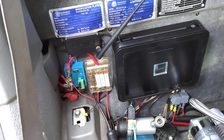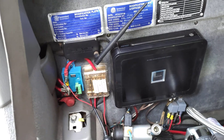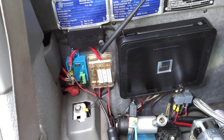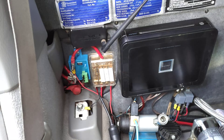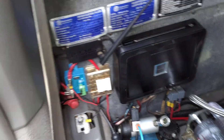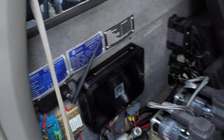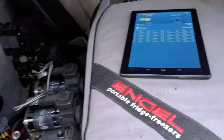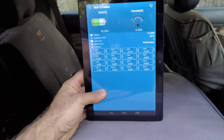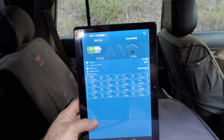It's a $65 device and it manages all the accessories. The battery charges directly off the vehicle's alternator — on this particular vehicle the alternator does around 65 amps at idle and around 85 amps under load when you're driving. You can deep cycle the top 90% of this battery pack, and 10% is automatically reserved by this device for engine starting. That's it — that is your battery system for this entire vehicle.